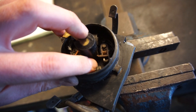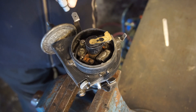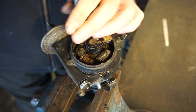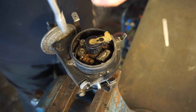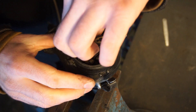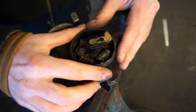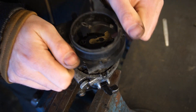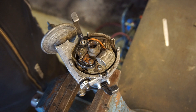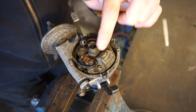So we're going to take these out in a little bit. But I'm going to set up the camera on the other side with some extra lights and show you how to adjust them. Before we adjust them, I'm going to do one thing to make things easier for you to see. On this particular distributor, this part here is plastic or bakelite or something and it can be removed. So I'm just going to remove it so you guys can see a little bit better - it's just a tiny little nut in there and a little plastic washer. And that's the connection - this is not something that you need to do just to adjust the points, but I just want to make it a little more clear. So now you can see how dirty it is. You can see the cam in here - it has six sides on it because this is a six cylinder engine.